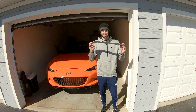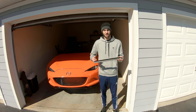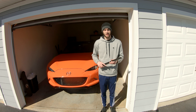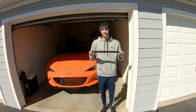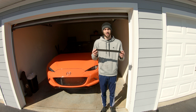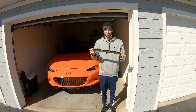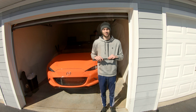One thing to mention is this little air deflector piece — Mazda says it is required with the front lip on this car. Not sure exactly why, but I imagine it has something to do with the way airflow underneath the car changes with this lip. Make sure you buy this piece; it's only about $25 or $26. There is also a different part for the RF, so follow the instructions that come with the kit. I'll be installing the soft top component and will include both part numbers in the description.